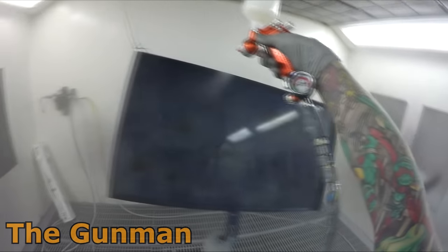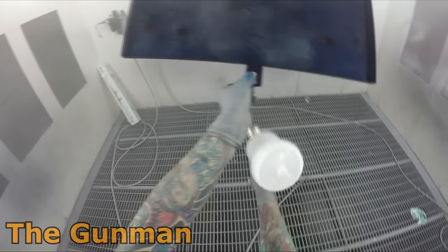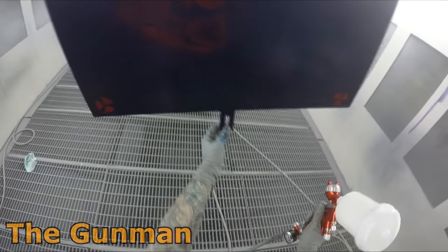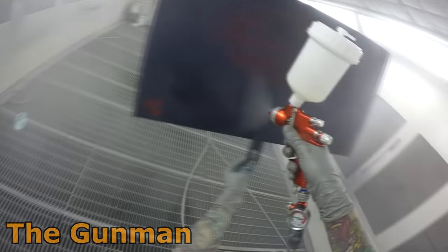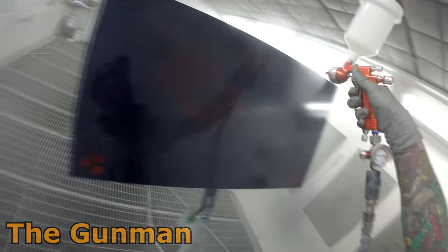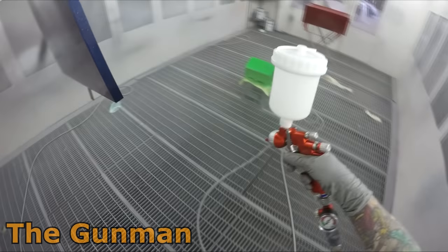You know, if you get those really vibrant candies, and especially if you go to flow coat them, that little bit of yellow can actually make a difference. So I actually did a VL Commodore respray. I'm sure a lot of you guys watched that, and I flow coated it with a good clear coat, and it was a little bit on the yellow side. There was two little pop-up headlight covers. Now, at the end of that job, I just got to the point where I'm like, you know what? I can't be stuck flow coating them. And the extra couple of coats of clear really did change that color. So it's just something to keep in mind.